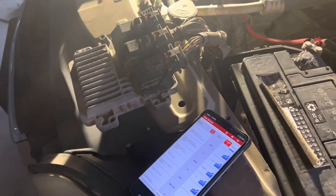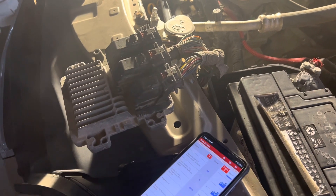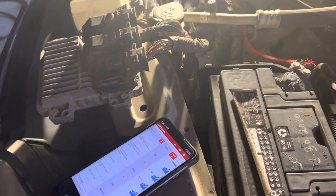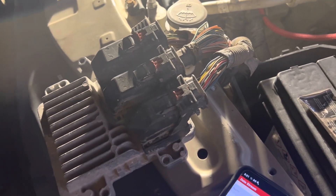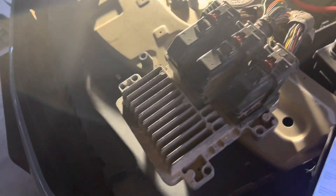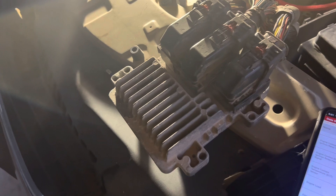So the next thing I'm going to do is check the wiring schematics, find out which pin and which wire sends the signal, and we'll activate it with the key on so the fans will turn on. The customer just wants the fans working. The issue might be with the computer but we're not going to go that route — we'll just bypass it so the car can start cooling.